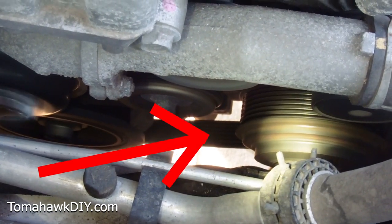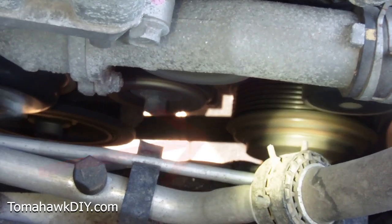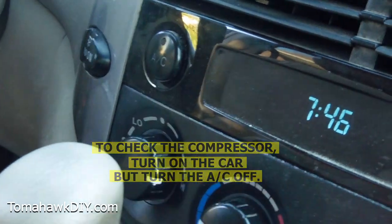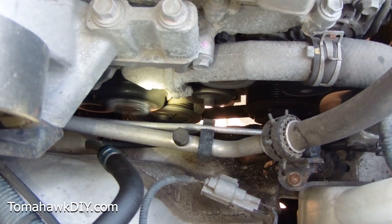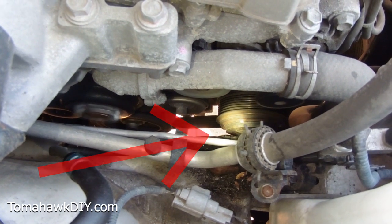It's going to be this one right here. Take a good look where the light's shining — the air conditioning compressor. Let's turn the AC off and come back. You may have to turn the air conditioning off of maximum and then turn off the AC button. With the AC off, we see the belts are still running but the compressor is not rotating and spinning, so we know our compressor is working.